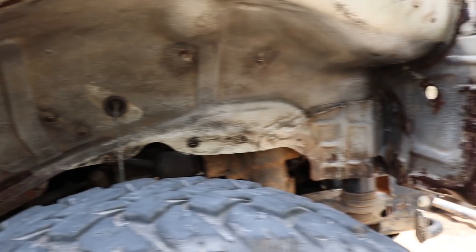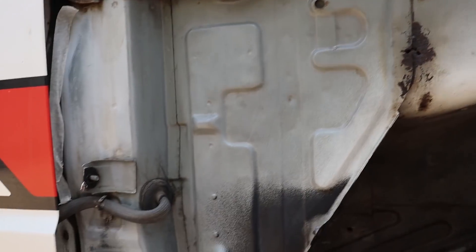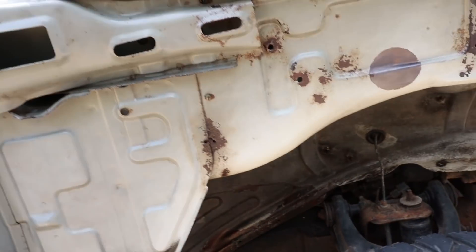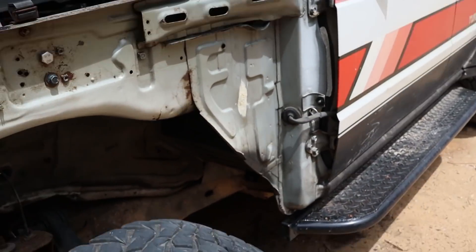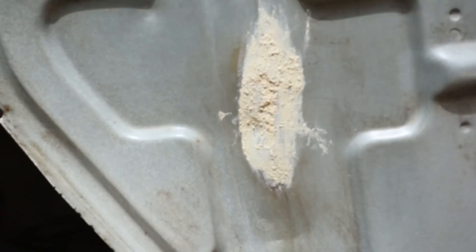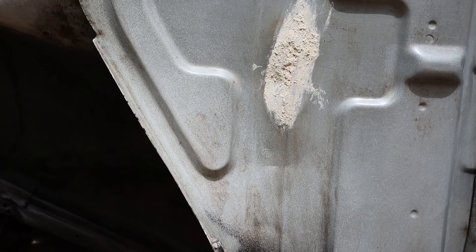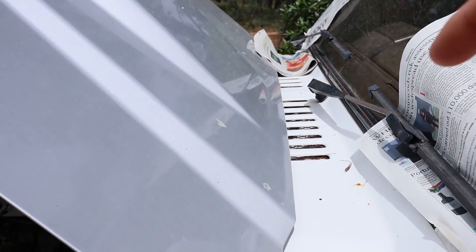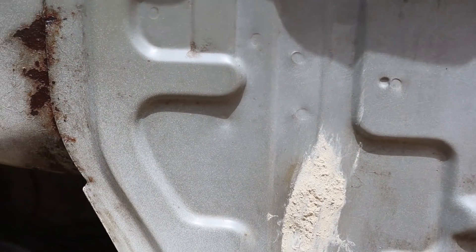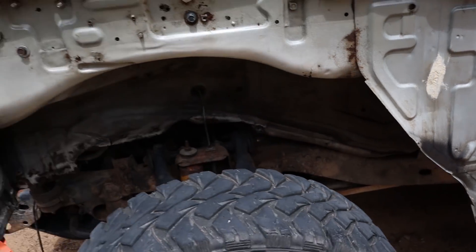You can see the rust has kind of gone black now because I've put the Vacton on. I've used a little bit of filler in the places I needed to, and I'll sand that off — it fills the hole that actually went through to the cab, which is not cool. That's where the windscreen drainage is — the water runs down and can run straight in. It's a common problem but I caught this one nice and early, so I'll fill and sand that before paint.